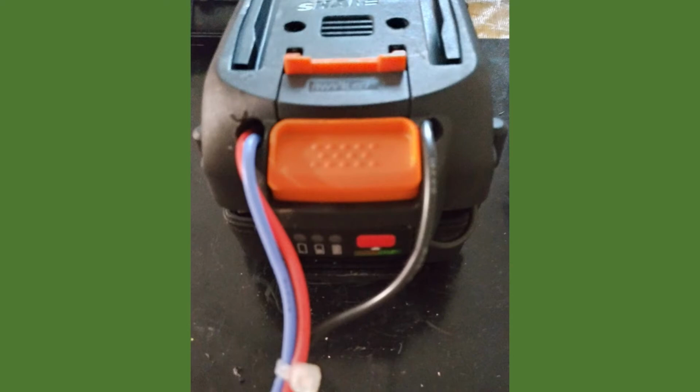Here, the battery has been closed and 2 holes drilled in the ends so that the additional wires that have been added can exit. Now, it wouldn't be necessary to have 2 holes. 1 hole large enough would do. And the other point to make is that the holes need to be in the general area shown so that the battery can be inserted and plugged in as normal, and the wires will reach up to the lid and join with the other 2 batteries on top of the lid.